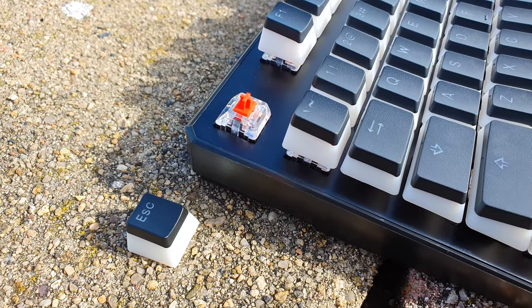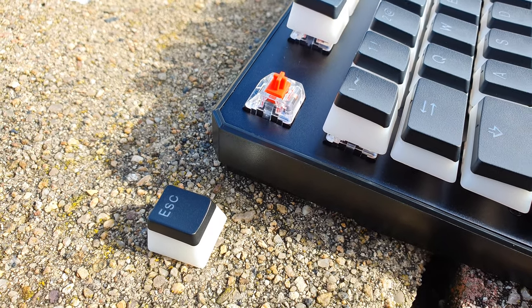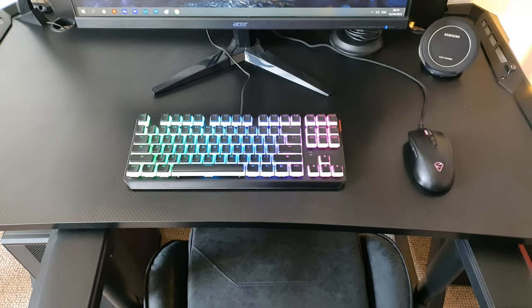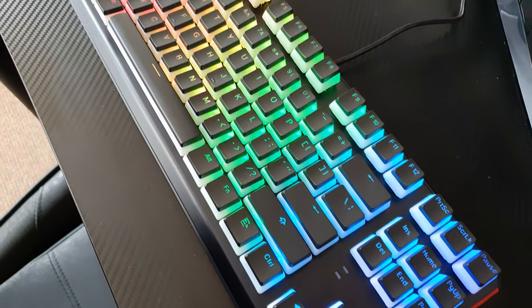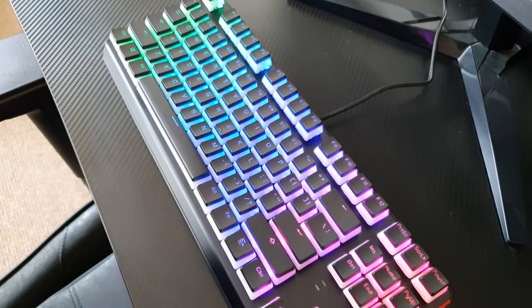This series is powered by Kailh mechanical keys, and in my sample I have the red ones. They are essentially an almost direct correspondent to the Cherry MX keys. Thus they are gaming keys, as they have a short stroke — actuation point is around 2mm and the total travel around 4mm. They are silent in operation and require less actuation force, around 50g. The transparent base is of course for the RGB lighting.